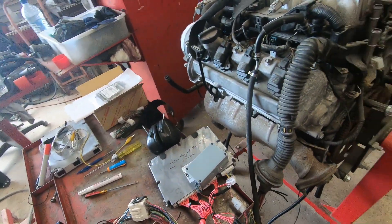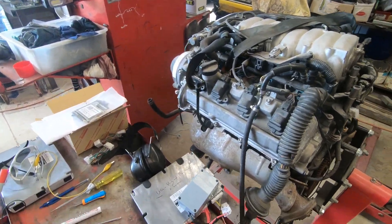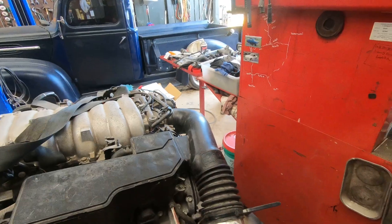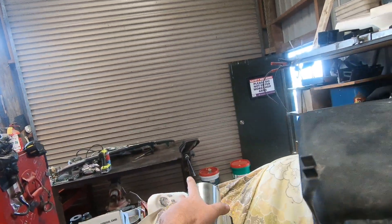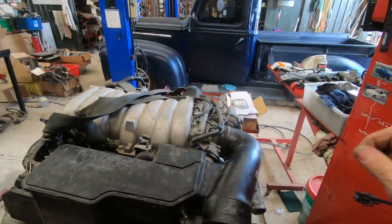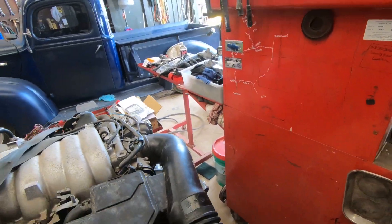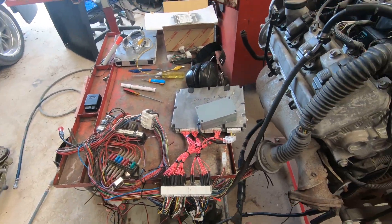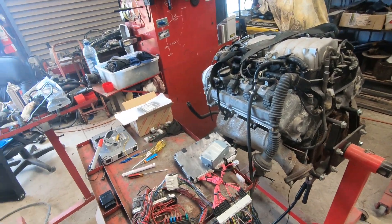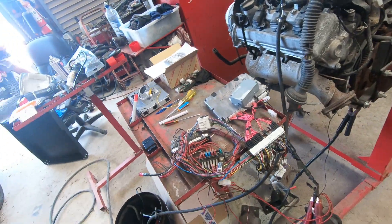There's the loom. We'll just quickly plug the three plugs from the engine on that one. These are quite different pinouts, hence the need to make the adapter. Here's my immobilizer box — the light starts flashing, it's good. We're going to swap the airflow meter. I've made it easy fit with a zip tie, and we plug that one in. So a moment ago it was running on a 151 Crown ECU — it's the same pinout as a 20 series Celsior. And now we'll make it run on a 171 Crown.